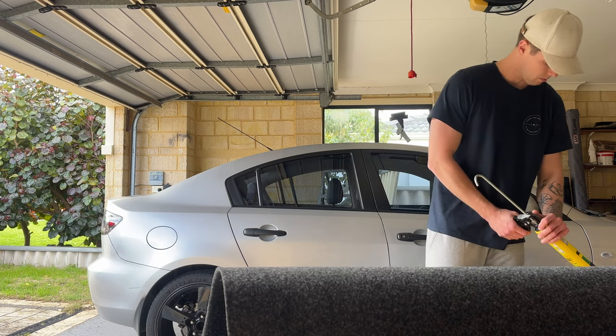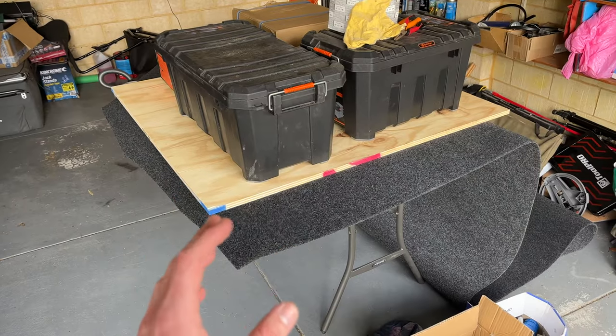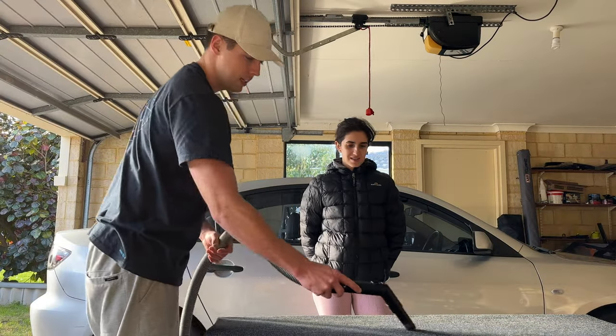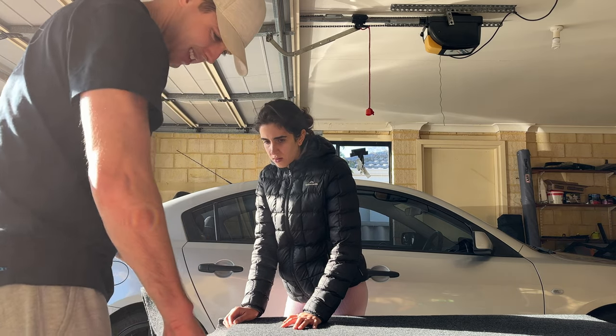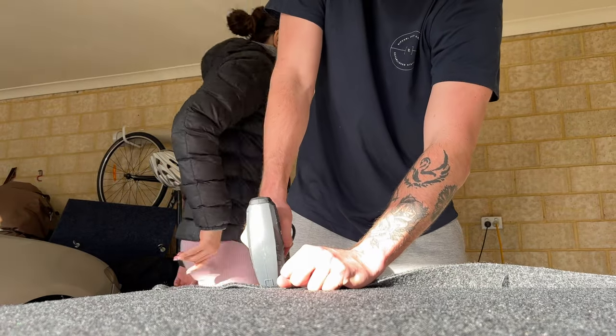The next step is to glue the carpet onto the plywood. The glue I use is just liquid nails — make sure you get liquid nails that suit plywood and carpet, or use whatever other adhesive you prefer. Once you've got the glue, carpet, and plywood all together, it's good to use a bit of weight to allow the glue to set properly. Once the carpet has set, you can cut the carpet to size. I like to carpet both sides of the plywood to keep it uniform, but you can leave the bottom bare since you won't see it. Once the carpet is cut, use a staple gun to staple the edges of the carpet onto the plywood for a bit more support. Then you can start installing into the car.